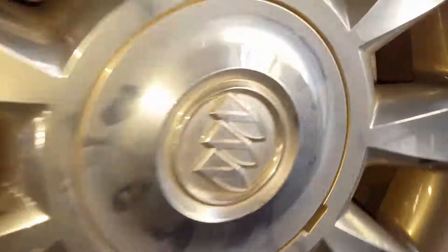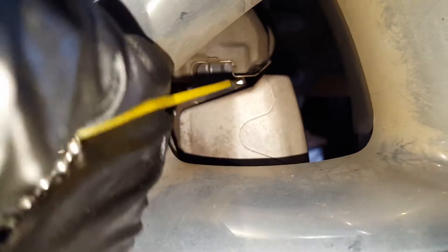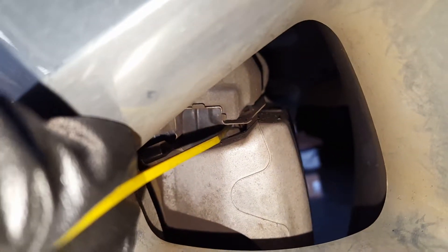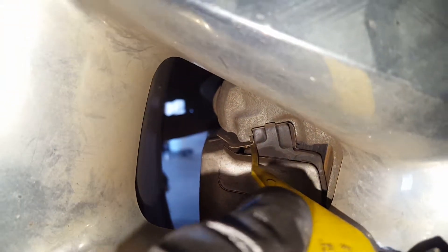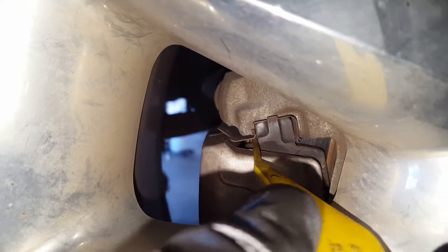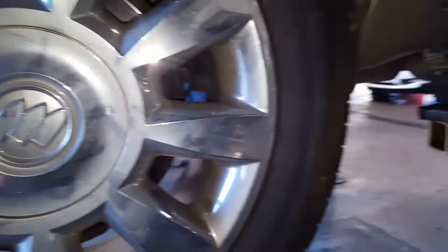On the back you have a slightly better four millimeters, but it still needs to be replaced because four is just one shy of being considered red. Same on your rear right — it's a four millimeter gap and it's a snug fit. So I'm going to recommend a new cabin air filter, new front brake pads, and new rear brake pads.